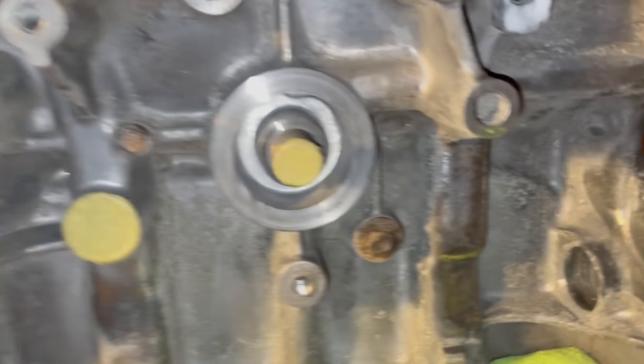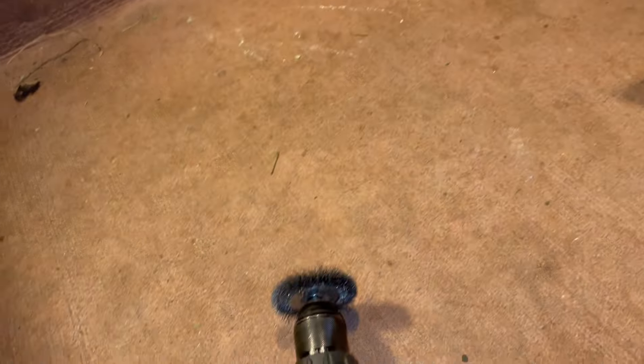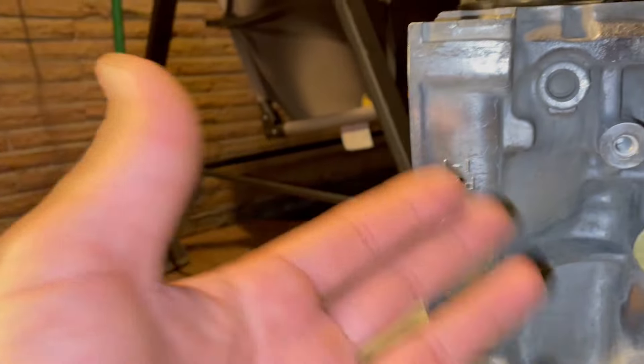What's your guys' opinion? Because I'm taking off the dusty-looking stuff but you can see it looks pitted — it's showing its age. I think it has about 150 to 200 thousand miles, just from the condition it was in before I took it to the machine shop, the leaks it had, and the condition of the bearings. My guess is it's probably closer to 200,000. So I don't think it's a good idea to keep going with the wire wheel, because I don't think I can take all the ugly stuff off before starting to dig into the cast aluminum and causing damage. I'm going to just paint this thing because it'll look a lot better than having it shiny with pits in it.